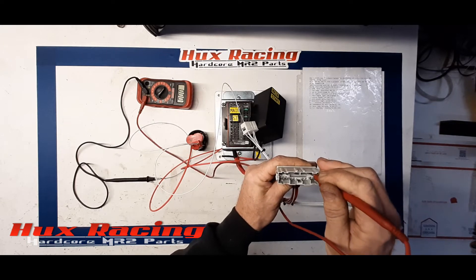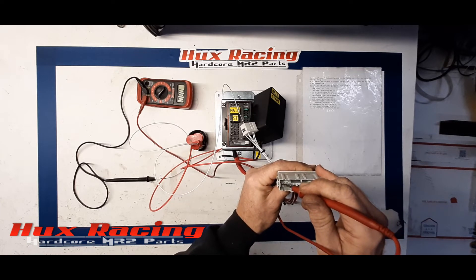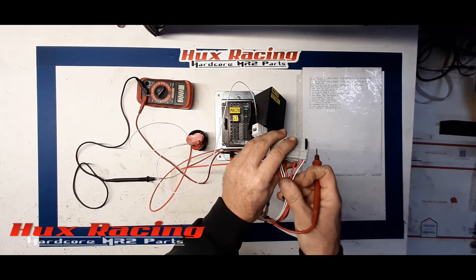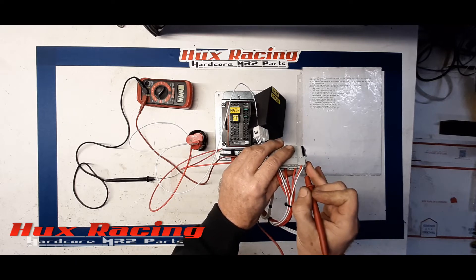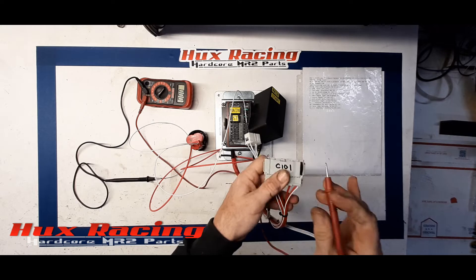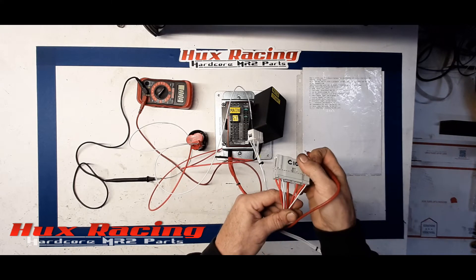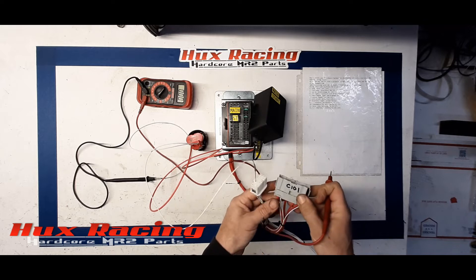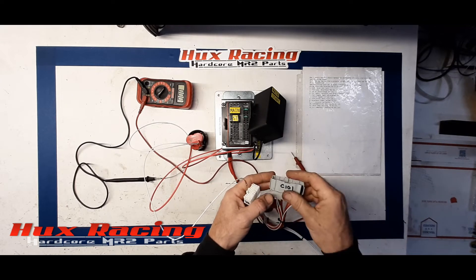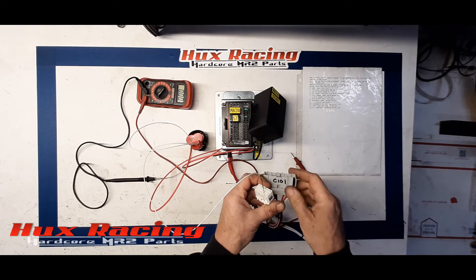Let me turn this so you can see — that's pin 14, that's 20, that's 9. Now if you've been watching our videos, I like to use position 1 and 2 for the reverse lights. On this one the 12 volts will be on pin 2, and that should have 12 volts also. So we have confirmed that the main relay functions properly if the ECU commands the ground trigger to pin 7.